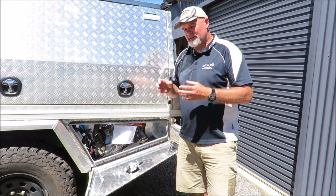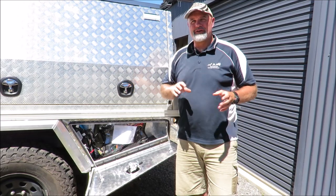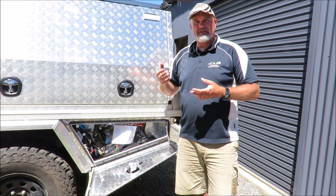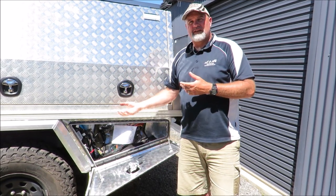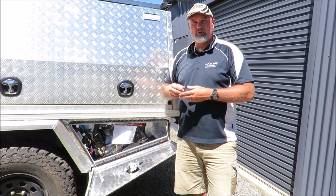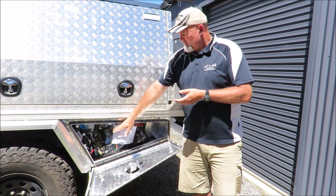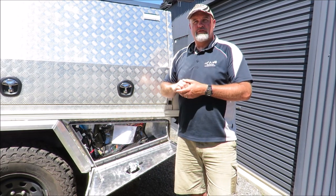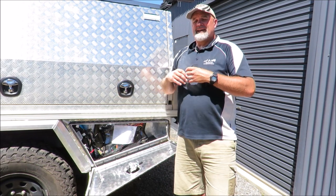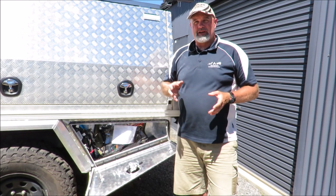If you use the Enerdrive chart you can't go wrong. Now, what happens if you do get it wrong? There's Ohm's Law — I'll give you a basic rundown. What Ohm's Law says is: the higher the resistance, the less voltage you have and the more current you'll have. So if you run a cable too small, you'll have resistance, you'll have voltage drop, and your amp draw will actually increase. The ARB is 23 amps, but if the voltage drops off, the amp draw is going to rise — then you risk blowing fuses, and worse, actually melting the cable. It can have some pretty catastrophic effects.